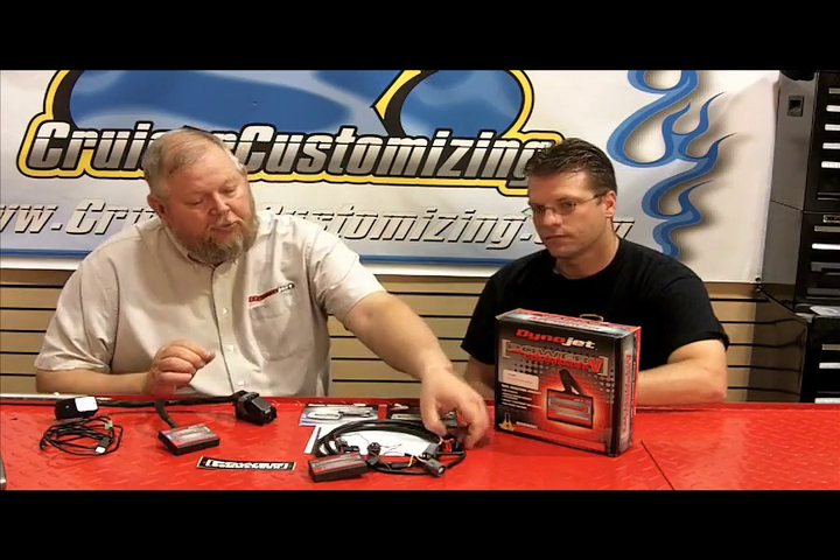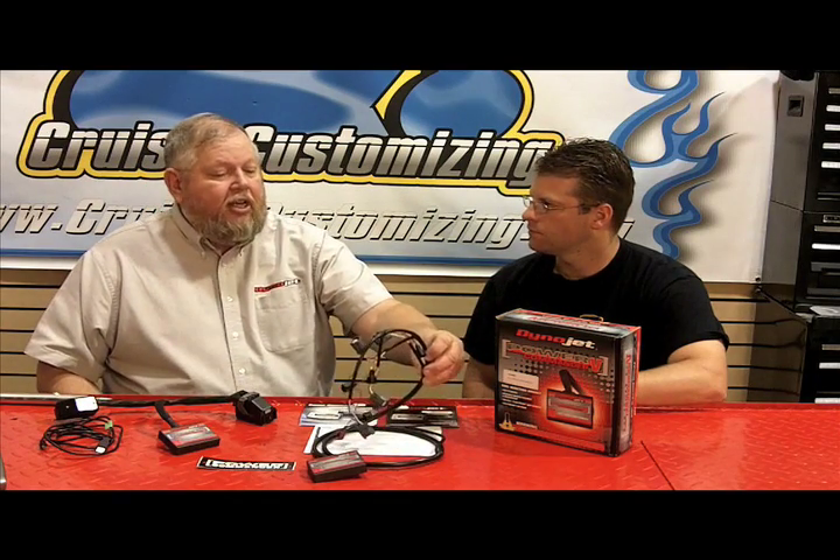With the Power Commander 5, the first thing to point out is it's less than half the size of the Power Commander 3. As these newer bikes have gotten less and less area to store a unit, we've compensated by cutting a lot of the size out of it. We are still a direct plug-in — this particular unit is for a Harley and has the big gang plugs, while this one is for a sport bike such as a CBR 600 and plugs directly into the injectors. We're not cutting or splicing into harnesses; we are plugging into factory connectors. With the Power Commander 5, I can run dual maps, tune each cylinder independently, and tune each cylinder in each gear — though it's so extreme that you very seldom need that level of tuning. I also have the option of doing ignition, adjusting start-up fuel, changing fuel according to engine temperature, and changing the accelerator pump. The list just goes on and on.